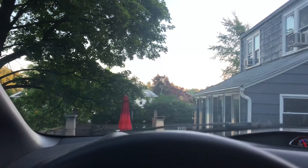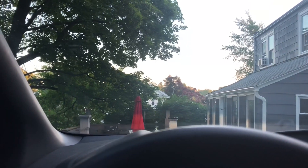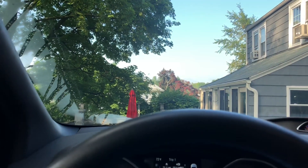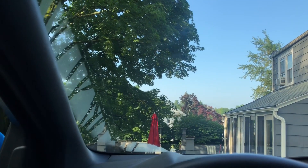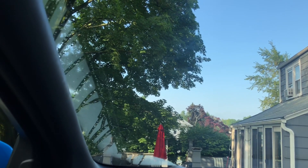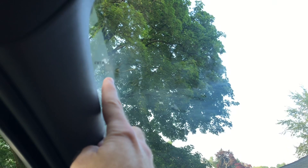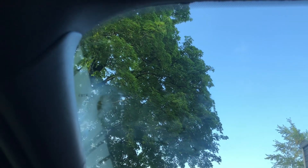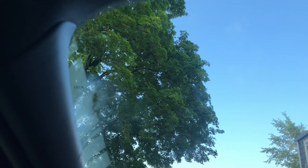Well, that's my video. If you like this, please subscribe. I'm gonna work on this again and see if I can get those things closer to the A-pillar. I'm not sure exactly why it's stopping so far away even after I calibrated it. I ended up doing the procedure again exactly the same way, however this time I moved the wipers out a little bit farther and it has definitely changed the calibration. You can see it's going closer to the edge now. It seems like you have to move the wiper a little bit farther than where you want it to go in order for the sensor to pick up where the wiper blade is. I guess the resolution of the sensor isn't that great. I may try it again, but I'm satisfied with the result and I should be able to clear my windshield without having a whole ton of snow left there in the winter. So I'm pretty happy. Anyway, thanks for watching.